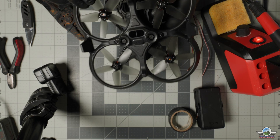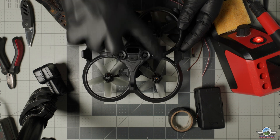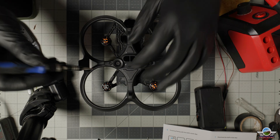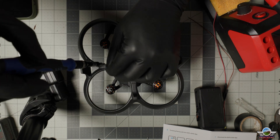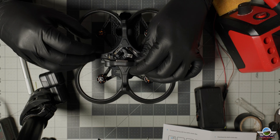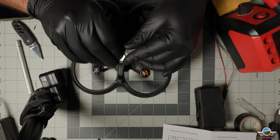Now to the DIY. First things first, flip your drone and you will see that you will have to take off the four propellers — they both have two screws each. Then take two screws beside the two little sensor cameras on the bottom part, and very carefully remove the optical cable that connects into it. They are very fragile, so be very careful.